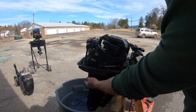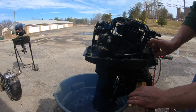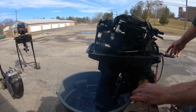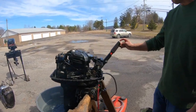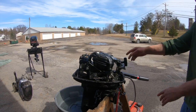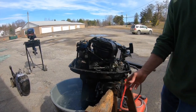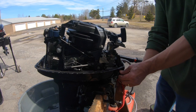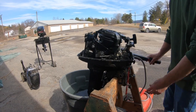I'm looking down here to make sure there's water coming out of the port — there's not that much water coming out; there should be a little more than that. It's coming out a little warm; I hope it increases over the next couple of minutes. Let's make sure the kill switches work: the kill switch at the end of the tiller works fine. The lanyard kill switch works too. The motor is working okay, but I'd like to see a little more water coming out before taking this into the field.